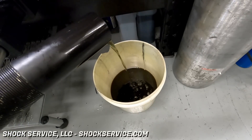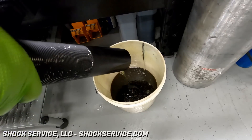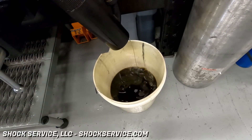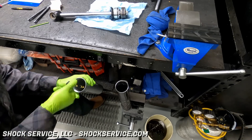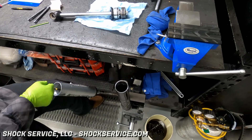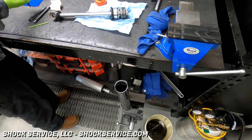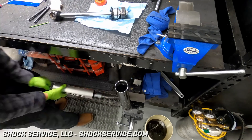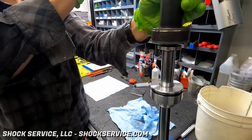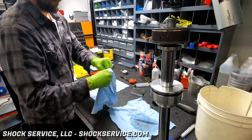Clean it all up and you move forward. Generally if you can get a nice smooth pull on that shaft, you can burp a little bit of air underneath the piston, which offsets the vacuum you're fighting against. But every once in a while it just frees up unexpectedly. What Steve is doing now is pushing the internal floating piston in the reservoir all the way to the end and measuring that depth — giving us the maximum IFP depth to help set the proper position during assembly.